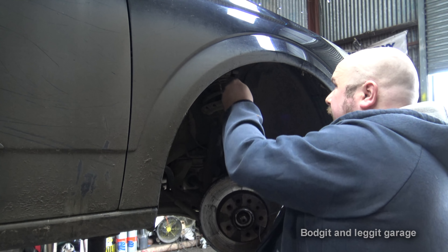Line up our mark — there, that should line up with that. Just put that on first to kind of hold the disc for me. Need to find a proper squirt bottle because when you put brake cleaner in all-purpose bottles like that it just destroys the bottle, as you can see it's not really squirting out properly. But not to worry — nice and clean. Let's get the carrier back on, which we've cleaned, so we're all good.